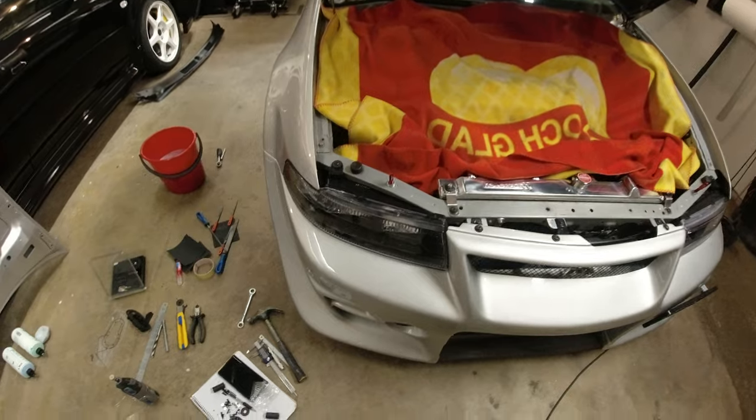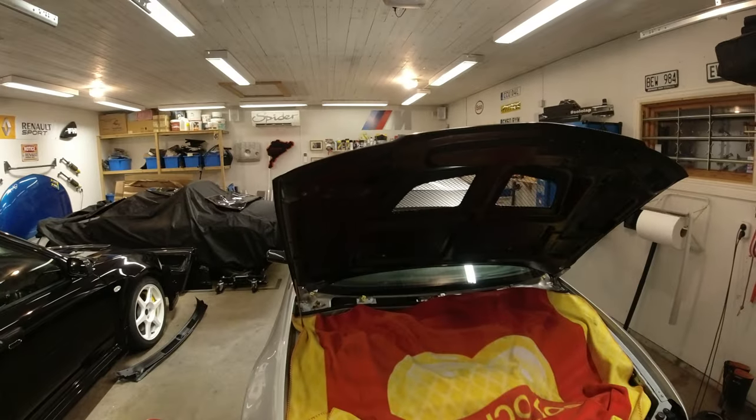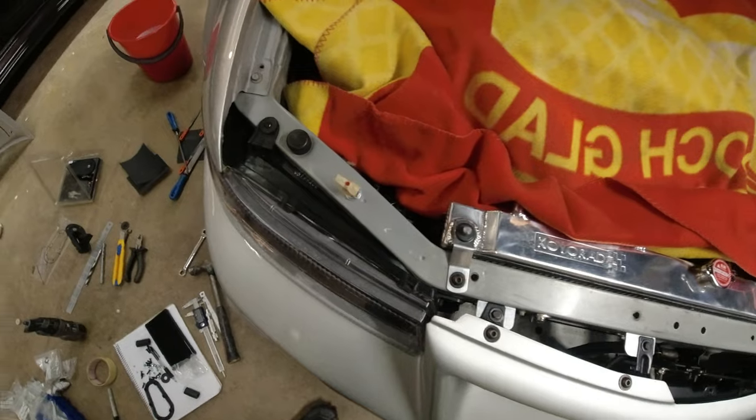So the next thing I want to do now is put a little bob of paint on the top of each pin, and then once we've done that, shut the bonnet, see where the paint mark is, drill a hole in the bonnet. Do the same thing again, shut the bonnet, when we get to the outer skin, drill a hole through, and once we've done that, then we can get onto my little template that I'll show you that I've made, that I've kept from other aero catches that I've done, that will give us the perfect shape and fitment and position and everything for the aero catch itself. Then we can cut it out, get it sunk in, and we'll be done.